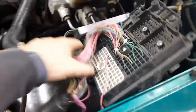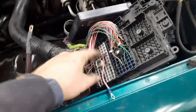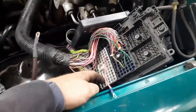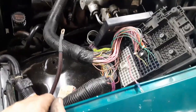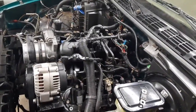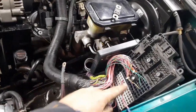That's the basic harness. I didn't cut anything — I spliced into that one wire on the back of the fuse block connector. On the stock connector I just removed all the wires from a bunch of positions so there are no funky voltages grounding out or catching my car on fire. Stock harness, stock fuse block, one extra wire, and you're done.